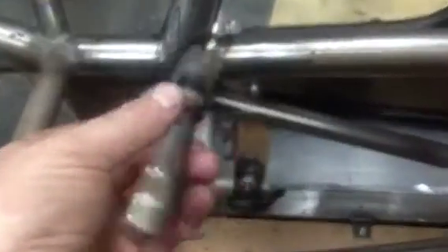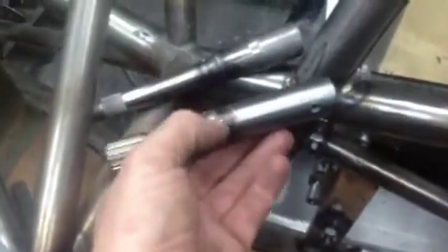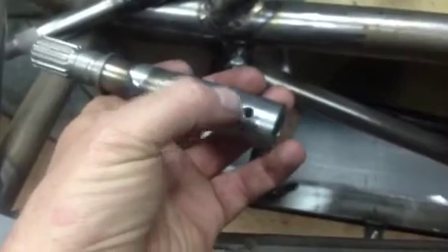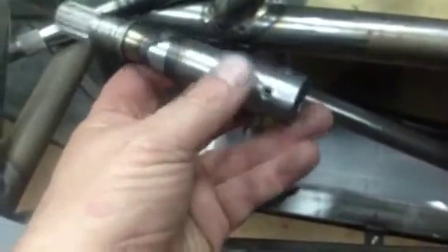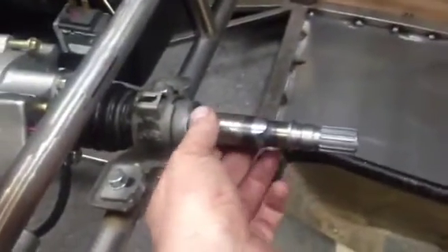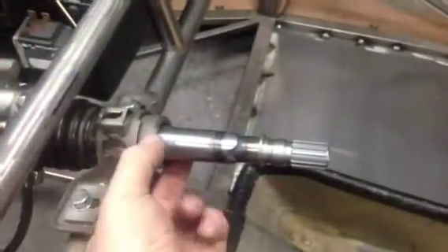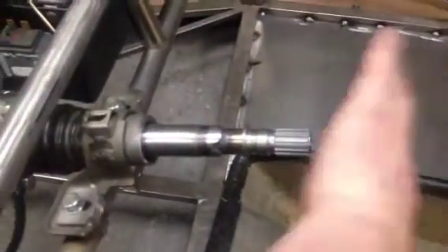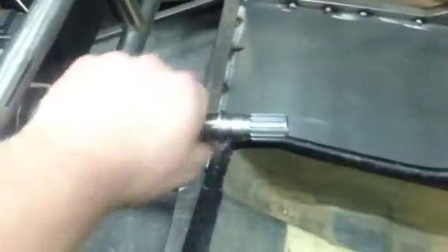That's a unit I had before that I've chopped up just to see how everything goes. This is the actual one - that used to be that. There's two small tiny holes. I've drilled them out so I can put grub screws in. Basically what GM do - or whoever the supplier is - they hold it in its correct position and inject hot plastic through those two holes into the shaft, so the shaft itself becomes one with the other one. I'm guessing an impact hard enough - if you hit the steering wheel fast enough - it'll push it forward, which gives some compressibility as well as the tube that will compress here.